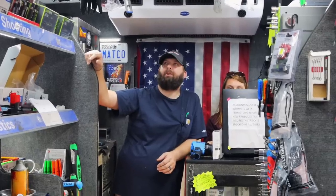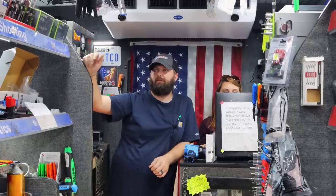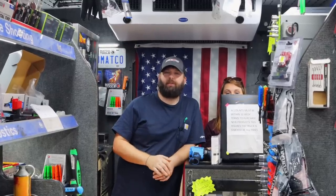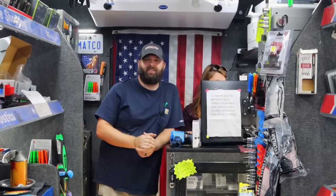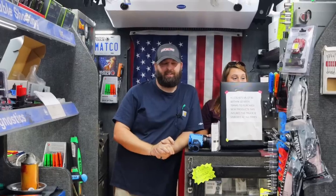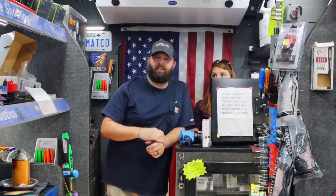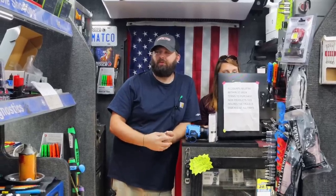That's it. Not only that, but I don't want the porcelain to crack on the spark plug. Because if you've ever done a 5.4 Triton, break one of those in the back, or crack one of those and have to go back and redo that. Oh yeah, pull it out with that spark plug puller. It just sucks. In general, they suck to get to, and even if you don't break it off and you just crack that porcelain, now you've got to take it back out. You'd be mad at yourself, which we do see.